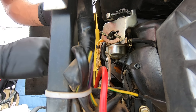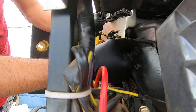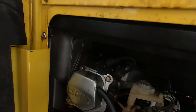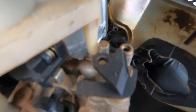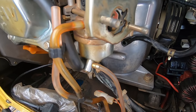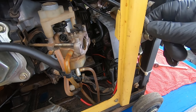This gasket goes in between the box and the choke mechanism. Next you're gonna slide the carburetor forward a little bit — slide this forward together with the carburetor. This is very important: there is a pin that aligns with the hole on the choke mechanism, so when you put this back together make sure you insert the pin there and then slide everything together. That way when you operate your choke it opens and closes easily.